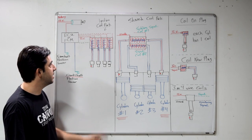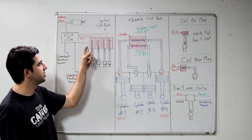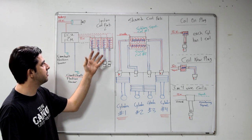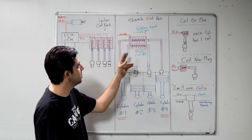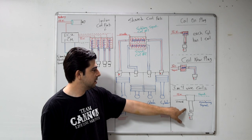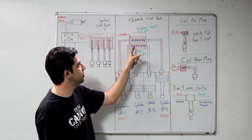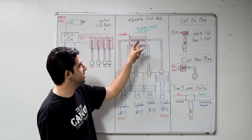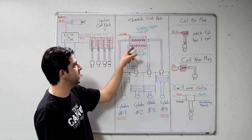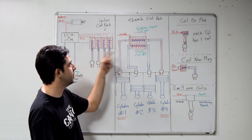Just to clarify: sometimes you get a ground wire from your ECU to your coil pack just as a precaution to ground the base and eliminate leftover static electricity. But other times a coil pack works similarly to the coil-on-plug types, where you get 12 volts, a ground, and two igniters inside that do the switching internally based on the signal from the ECU. Generally speaking though, most coil packs work like the ones we covered earlier.